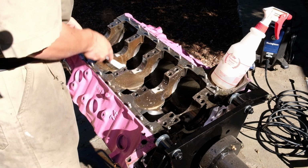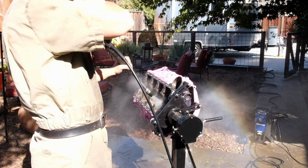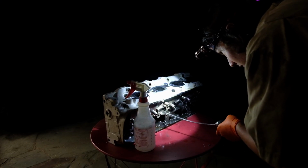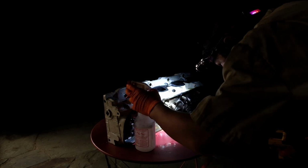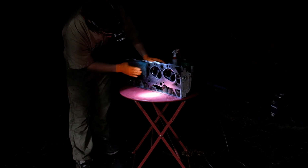Blown engines are funny and all, but after the first time, it's not funny anymore, and I kind of need this thing to work. Last time the rocker studs came out because I left oil in the threads, so I get to go through all the holes with degreaser and a wire brush. Kind of important when using any sort of thread compound.